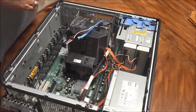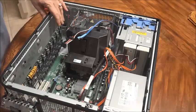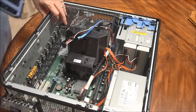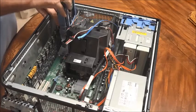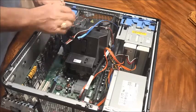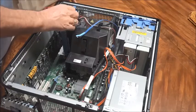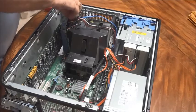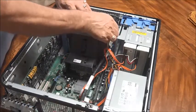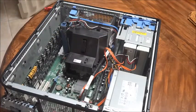You'll notice the fax modem is in there — you can see how long it is. There's no way we could have got it in there without removing that metal tab. Now put the hard drive back in, and make sure you pull the board back a little bit so you don't hit any of the diodes on the other side of that board. Stick your hard drive back in and there you go. Plug your plugs back in and you're ready to rock and roll. Please like and share this video — thanks for watching, we'll be back with more. Have a great day, bye for now!